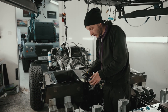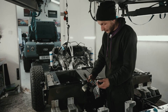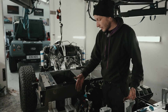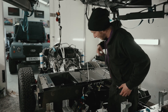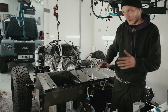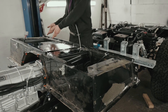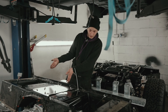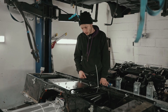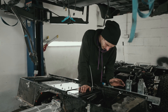I'm going to have to mount some of this control stuff because you need access to it really — if a fuse goes for whatever reason, you want it to be convenient to check. Where your factory battery is, you've got good access with the clip; it's under your seat. If you've got pull-up seats, it's dead easy to get to, so it makes sense to put it in there. I'd like to put it on this side where the other fuse box is, however there's not enough room, so I'm going to put it where there is room.